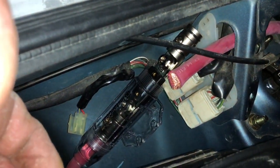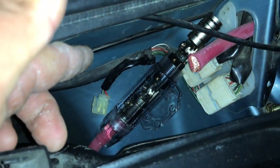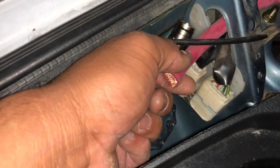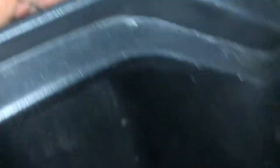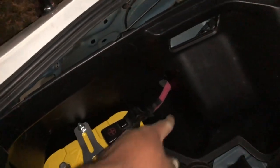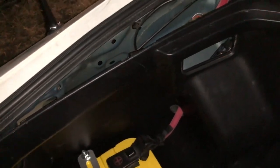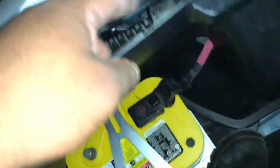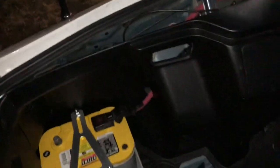I listened to that guy's comment about adding a fuse and here we have one — I'll put a link in the description. It's a 100 amp fuse and it's pretty big. I already got one side done. All I'm doing is cutting the wire, exposing a little bit, shoving it in here, using the Allen key to lock it in place, and then putting the plastic cover back on. I think I messed up the hole where I decided to drill, so I'm going to drill another hole and mount the fuse in a better spot, maybe run the wire through here. Celicas are pretty common here in California so I might go to the junkyard and get a whole new panel.